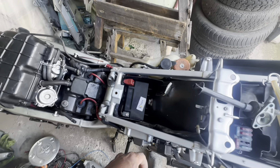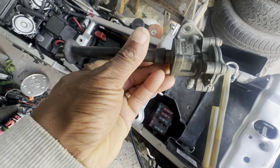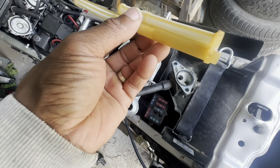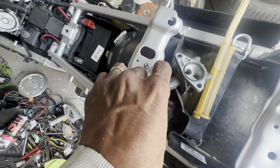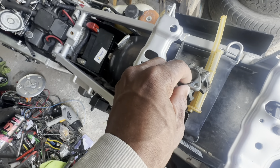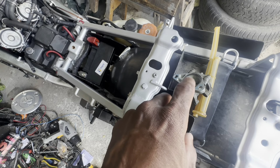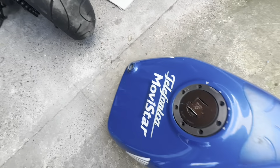As far as parts are concerned, I have this fuel stopcock and filter assembly. This is the filter here. The rubber seal, or o-ring, is a bit dry and old and crusty, so I've got a new one that's arrived. I'm going to be replacing this, and then I can put the filter back on and fit this to the bottom of the gas tank.